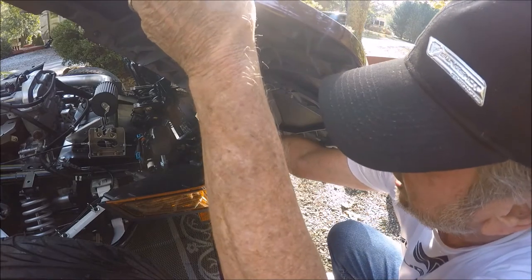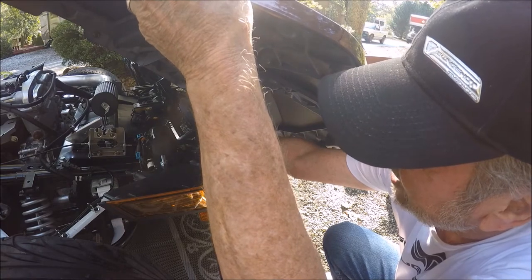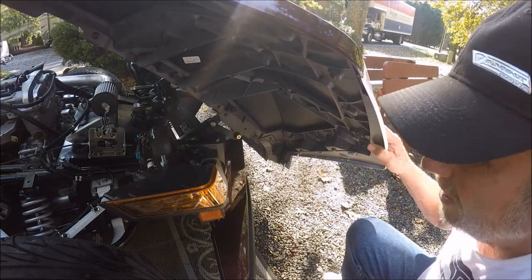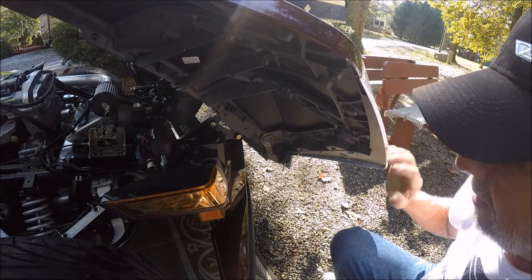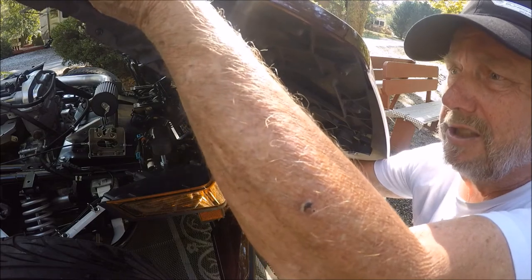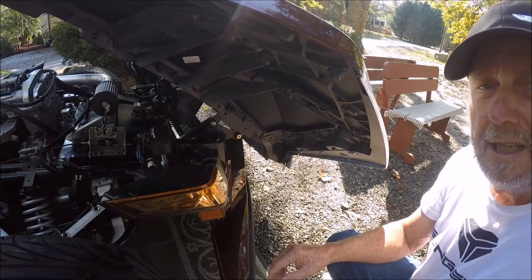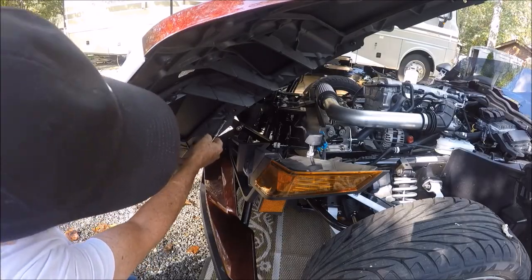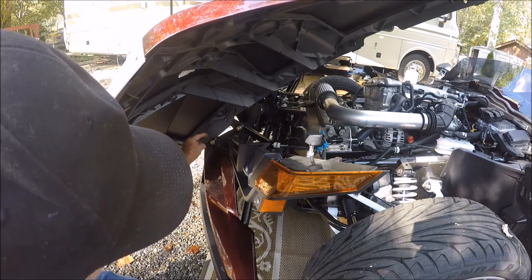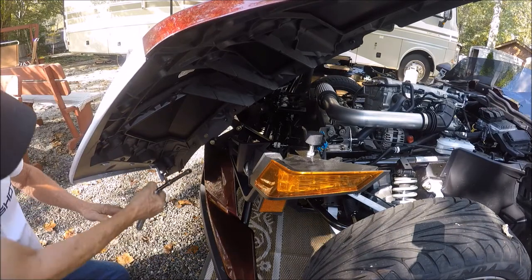This hinge pin — or pivot bolt — is acting as a pivot point right now. The other two bolts on the other side are holding everything in place. But when I take this bottom bolt out on the other side, I need to have someone holding the hood because then the back of the hood is going to flip down. So let's go to the other side — I'm going to take this one loose. This is the driver's side; this is a nut.